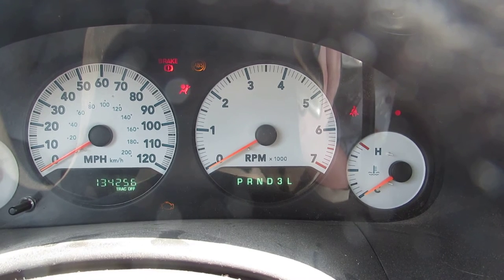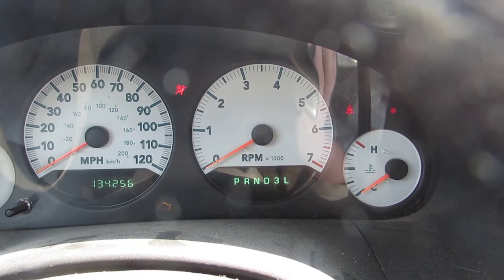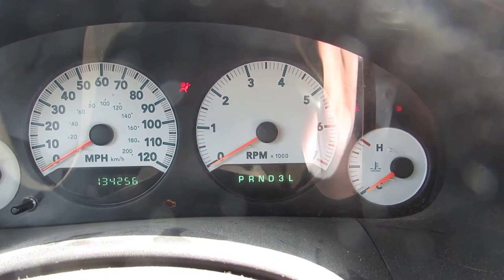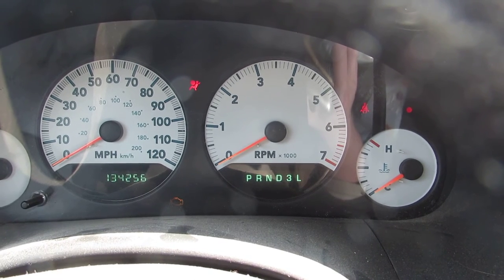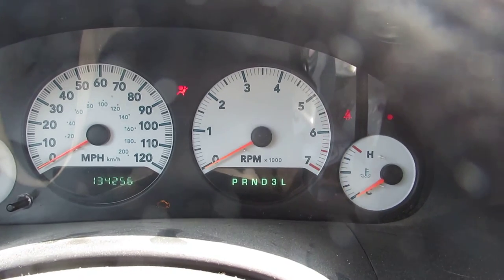The traction off light comes on below as well, which is what I would expect to happen if you were to cut the battery and then bring it back. That makes me think there's a little bit of a draw on the battery when I do it. The check engine light just came on, but I believe that's because the engine's not running yet. There's a definite click under the hood when you turn the key. I'm hoping somebody can help me out with this — any ideas?